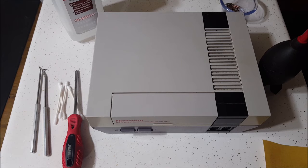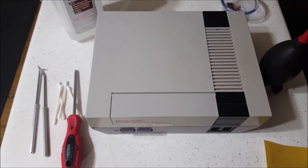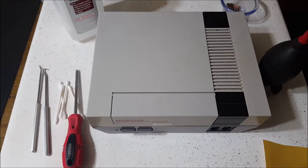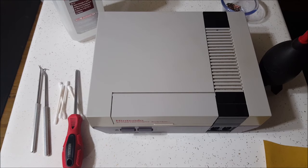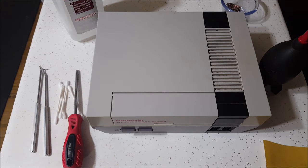I've had experiences with 72-pin connectors. Before I learned how to refurbish a Nintendo, I bought one on eBay years ago. Put it in and the pins were super tight — a pain in the ass — and it did not fire every time. My games could be completely spotless and it still wouldn't work perfectly. After I learned how to refurbish it and get them to play perfectly every time, I will never buy another 72-pin. I'll be at garage sales and people will have a brand new 72-pin and tell me it's got a new pin. I know that means I've got to change it out when I get home, because those new ones take the Hulk just to push the game in — plus they won't fire every time.